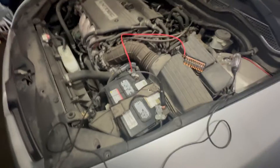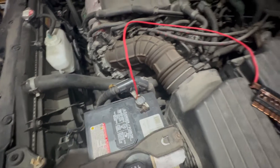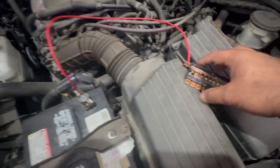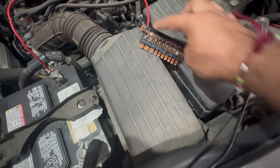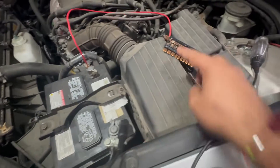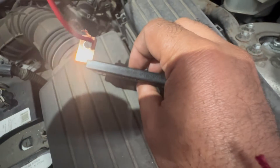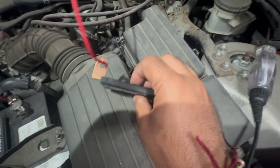If the contacts are complete inside, the fuses are good. You will have a code for the system that's controlling it. Anyway, let's bench test it with a test light. I have this circuit set up — the positive connects just like it would to the bolt here, giving the whole top half of the circuit 12 volts. Power travels through each fuse, and each fuse has a label on top showing the amperage: 30 amp, 20 amp, or 40 amp.